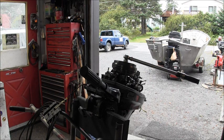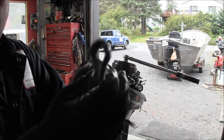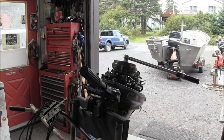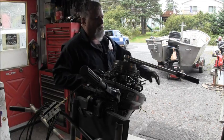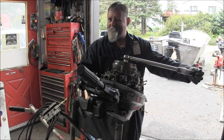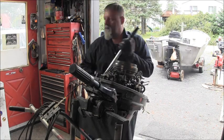I just take a piece of old cord from an old pull cord. One thing I generally do is fold it in half, make sure the piston's down at bottom dead center roughly, and shove it in. Now, we got to remember on this Tohatsu — it's lefty-tighty, righty-loosey. I've got it all set up, and listen — you'll hear a click. That's fifty-five. We're set there.